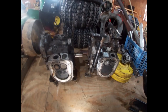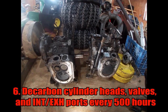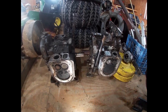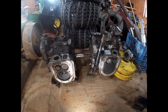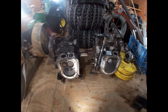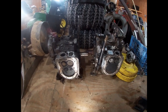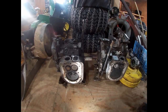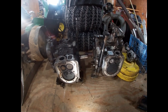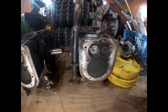A couple of minutes ago I mentioned decarboning the cylinder heads. That is another very important and often overlooked maintenance item regarding not just these engines, but pretty much any small engine. These are my two Onan parts engines here — a B43E and a B48G. I don't know how many hours are on either; they're torn down for parts. In an opposed twin that will typically suck a little bit of oil past the valve guides into the cylinders by nature, it doesn't take a whole lot of runtime to develop carbon buildup on the cylinder heads.